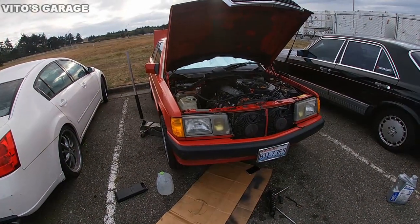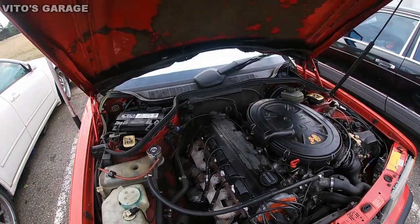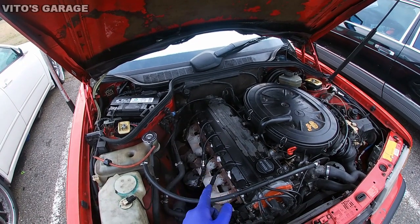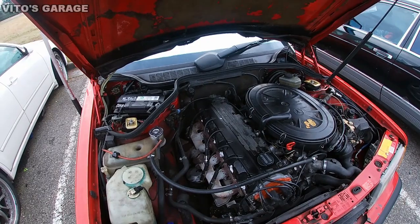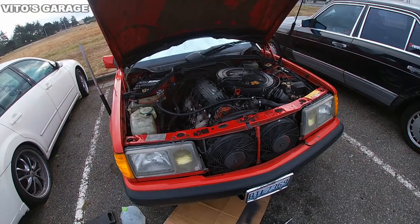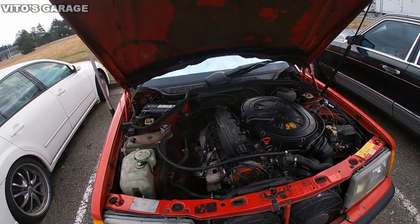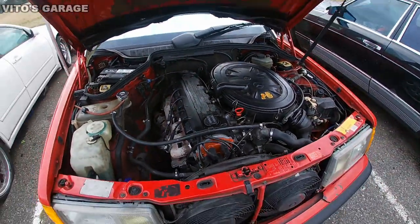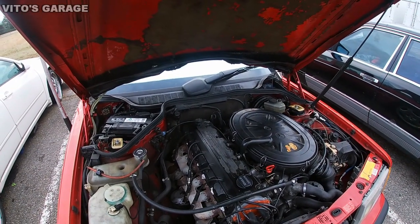We're back again, this is the next day — it's been 24 hours and I've been soaking the cylinders. These will purge, but right now before I crank the engine I want to change the oil, because some of the diesel purge went all the way to the crankcase and I don't want that. I've also driven around 1500 miles since the last oil change, so it's a good time to change the oil now.